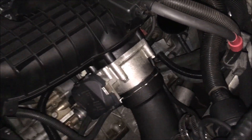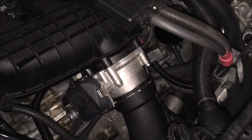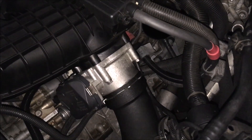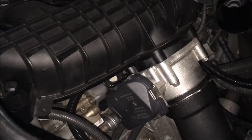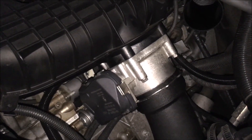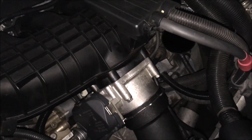It's pretty hot right now so I'm going to let it cool down. Basically once the throttle body is out of the way, we'll have a couple inches of space between the manifold and the charge pipe to work through. I think we're going to use a 24mm to get the sensor off and a 27mm to put the new one on, because it is an updated part.